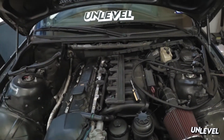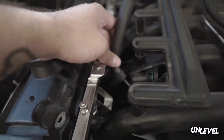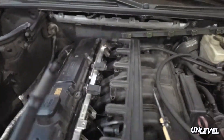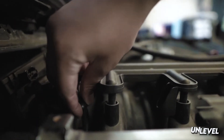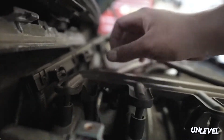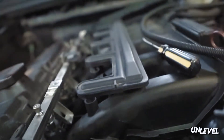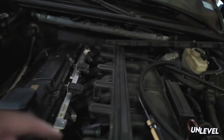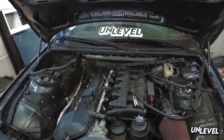I've got a disaster going on but I'm not needed inside — we're painting and I'm just in the way. I cut this off right here and plugged it here, so now the vacuum is plugged. Then I can start removing all this for the CCV, because my new valve cover has a piece that connects directly, so I go from here to here and can just delete the rest of the CCV system to get it out of the way.